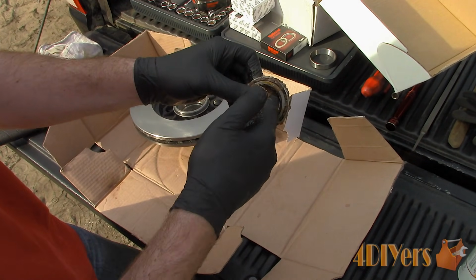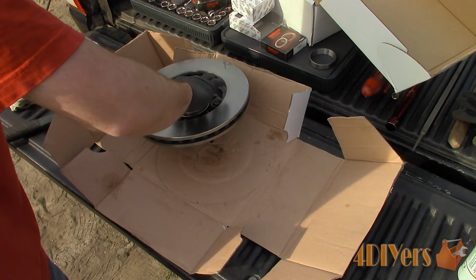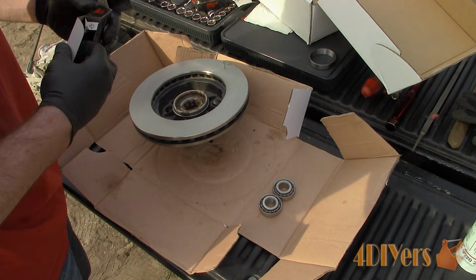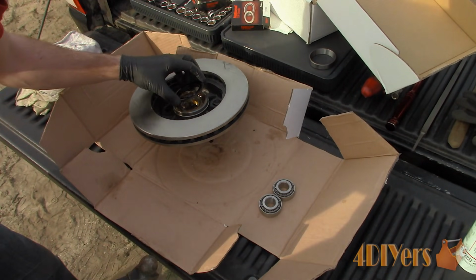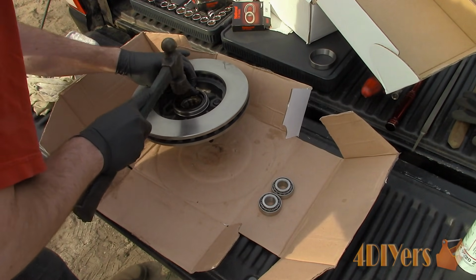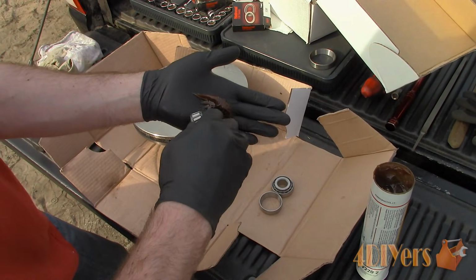Push the grease through the bearing, removing any empty spaces and pockets. Once satisfied, place the inner bearing in its location, and then apply some more grease against the bearing and around the edge of the seal. Place the seal in its location and gently tap it into place using a hammer on the elevated side. Pack the outer wheel bearing with grease as well.